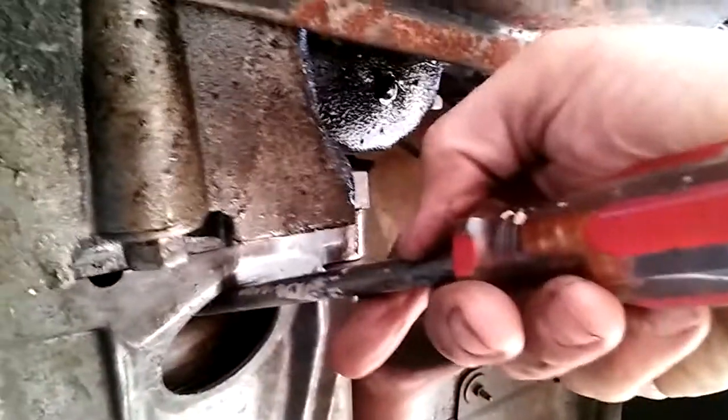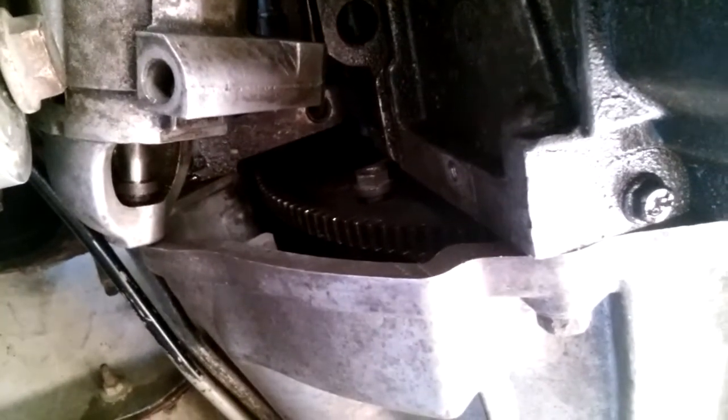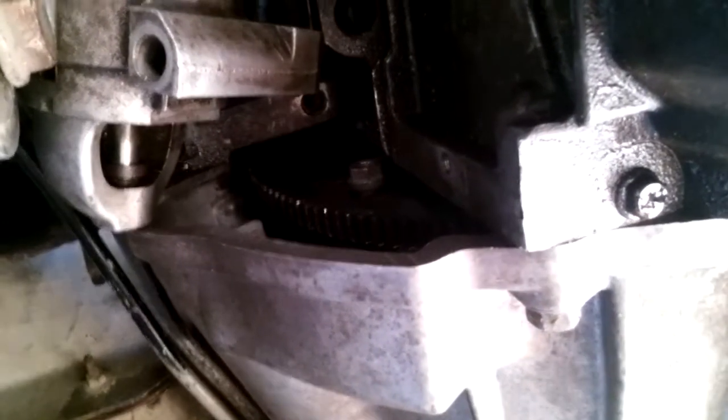So I loosened the one I was working on and tried prying the torque converter back a little bit — that didn't help at first. So I got a pry bar back here, you can barely see the bolt just hiding in the corner, and I pried against the bolt. That pushed the bolt even with the flywheel, which pushed the torque converter back, and I was able to turn it again. Now I'm tightening the torque converter bolts.